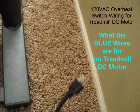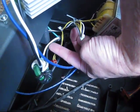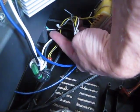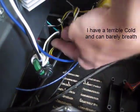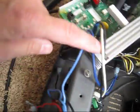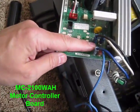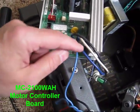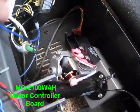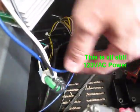We come out of the wall power — 120 volt AC — that comes in down here. You can see the white neutral, black hot, and ground here connects to the frame. They go through this ferrite core and come up here to the board. Here's your hot — the hot just jumps straight across to this blue cord via a jumper. This blue cord goes back down into the on/off reset switch — it's the top one.